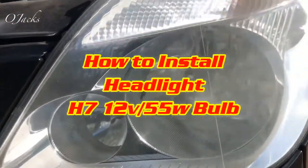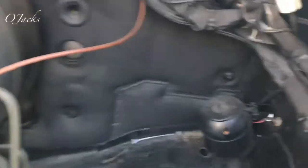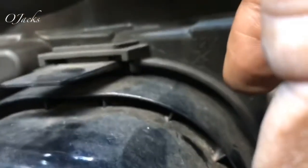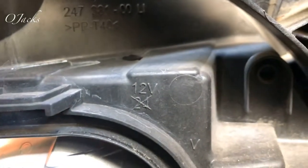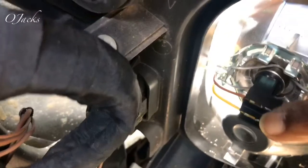This is a quick video on changing the headlight bulb on a 2000, 2011, 2500 Mercedes Sprinter. First thing you have to do is gain access to it, so these prongs right here — just pick up. It's sitting in a groove down here on these two prongs right here. So now you have access to the bulb.